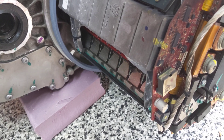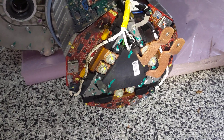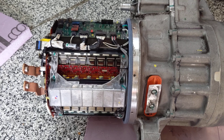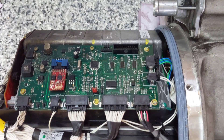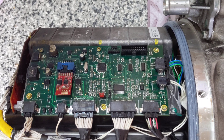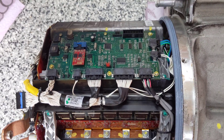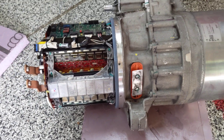It's possible to replace just one phase, probably, but I'm going to try to locate a sport inverter and get this swapped out and back on the road. While I've got this all apart, it's a good opportunity to look inside the inverter. This is the control board — you can see the Wi-Fi chip right there, the red chip. This is not the original Tesla parts; this is from Zero EV and Stealth EV. That's what's all programmable and giving us the ability to do what we're doing with this motor.